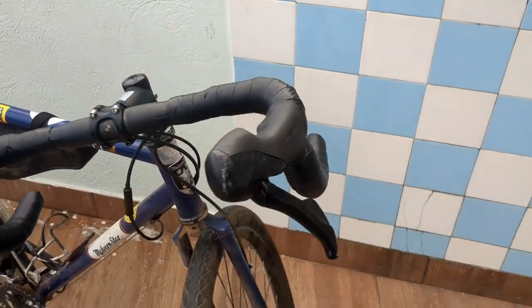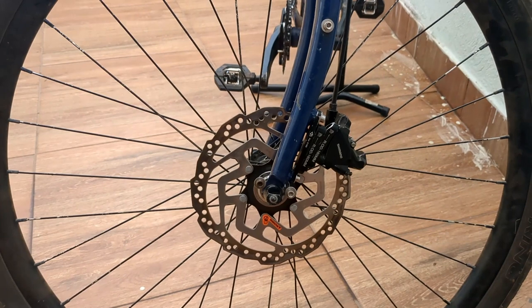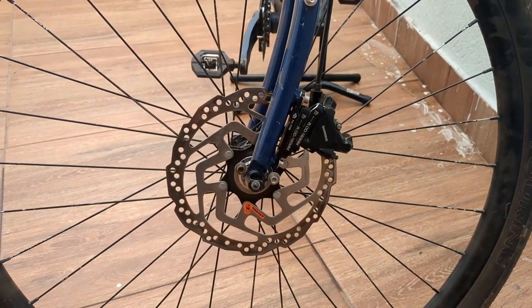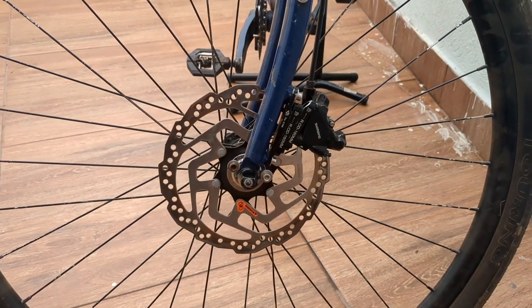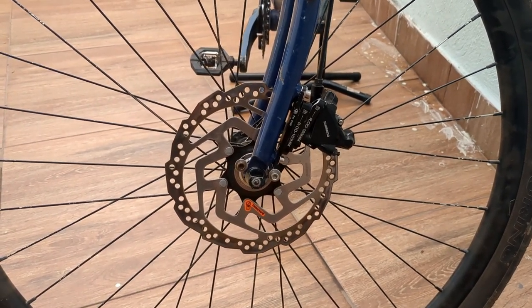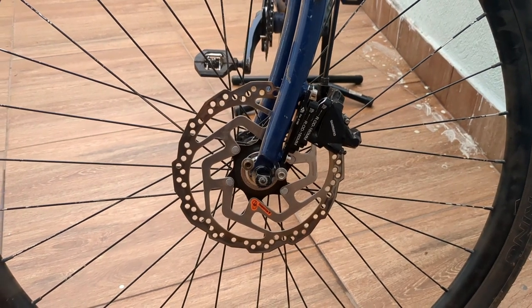The first thing I want to address is this — I use this bike for bike touring and I was traveling in Nepal. As you can imagine, I rode through very high mountains and very steep hills, and I was basically eating brake pads for lunch. The brake pads wouldn't last, and when I swapped to metallic brake pads, I started eating the disc rotors.